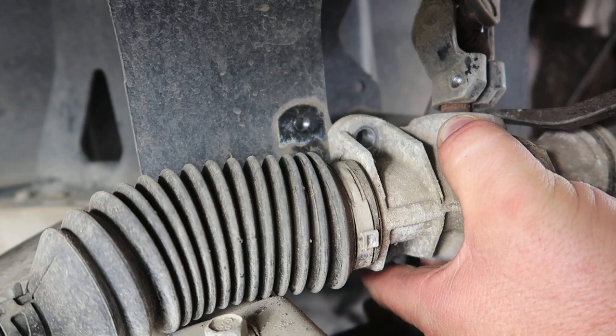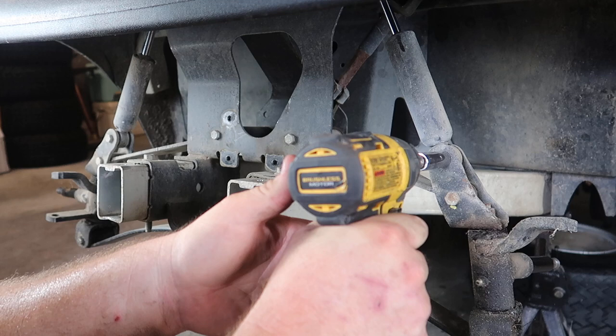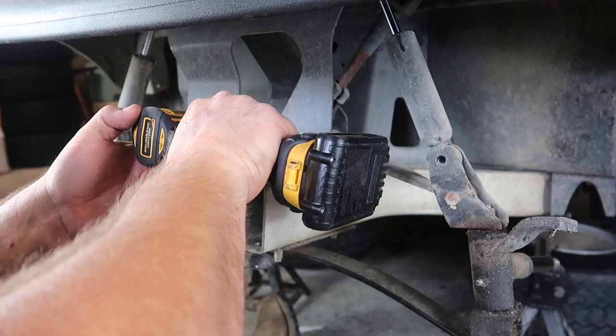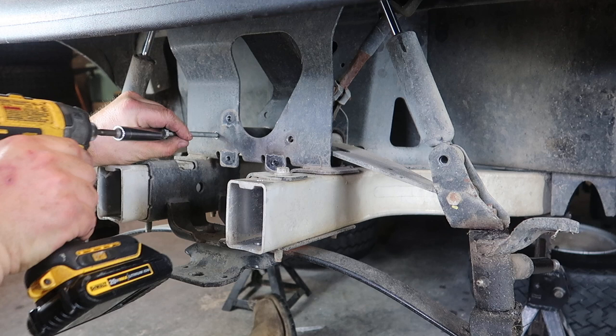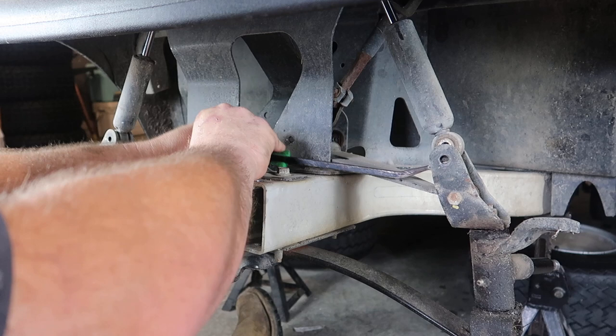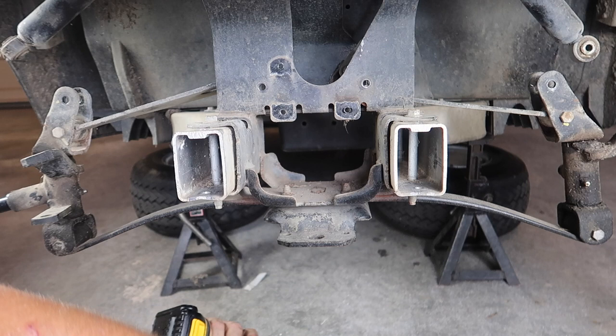Just take your time — it will eventually come off. Next, we need to remove the lower shock bolts and the upper control arm bolts. All of these are going to be a 13-millimeter socket. I used the impact driver to remove these as well. You do not need to use a wrench on the back side because they have a welded nut on the back of each one of these. The two middle ones we are going to reuse, so be sure to keep those. You might need to pry the lower shocks away from the top of the spindles. I continually use the 13-millimeter socket and impact driver to remove the factory lower spring of the front suspension. Once we have these four bolts done, we can go ahead and remove the suspension altogether.